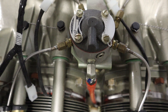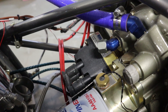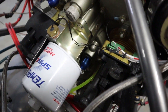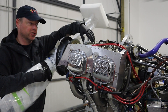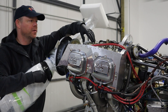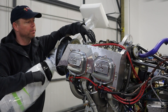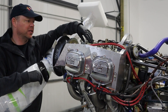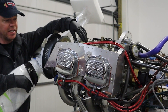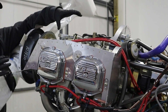The last thing it'll probably include is the ignition system, and there's a little bit of variation there — whether you go with slick mags or, in our case, a dual P-mag setup. There are lots of electronic ignition options out there. In discussion with your provider, the engine will most likely come with the entire ignition system complete so it can be tested on the test stand.